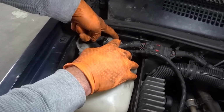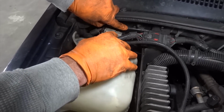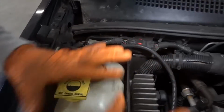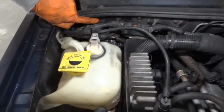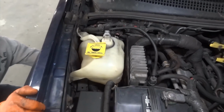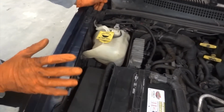They just pry them away from this frame. The ECM is on the back side of this frame. Wow, it's hidden back there? It's hidden back there. You remove this frame once you get all these other things out, by 1, 2, and then a third underneath there, a nut right under here. So that's how you get to the ECM. Not too bad though, really.